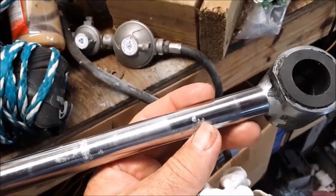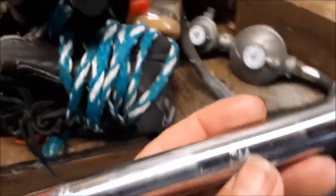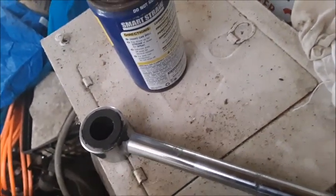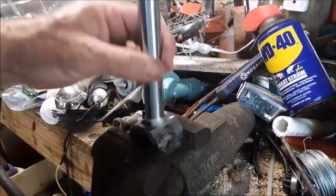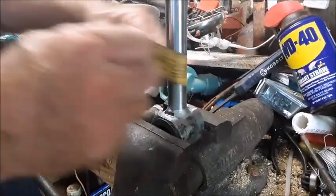After cleaning up this piston rod, we notice there's a little bit of gouging in a couple of spots, so it's possible the O-ring got damaged by a little bit of roughness there. We're going to start off by doing a little bit of sanding with some 320, then go to 1000, and follow up with 2000 to get this thing all smoothed out. These black sandpapers are meant to be used as a wet sand — instead of using water I'm going to use a little bit of WD-40 and wet the cylinder down. Using 2000 grit really puts a good polish on it. I went and looked to see how much this part costs and on eBay the cheapest one I could find was $287, so for the light amount of damage on this I don't think it's by any means worth replacing. If you had a really bad pit in it, you could consider cleaning it up, putting some JB Weld on it, and using sandpaper to smooth out the JB Weld.